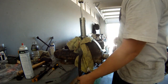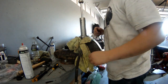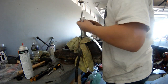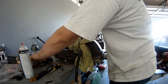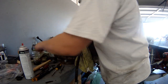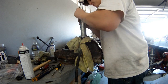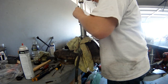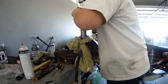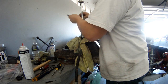The pressure has been released from the reservoir, so the next step is to pull the seal head down. It's just a light pressure. If it's stuck, sometimes I'll just take an extension and a rubber mallet and just tap it a few times. Then you want to remove the snap ring inside.